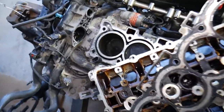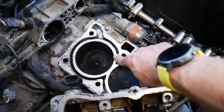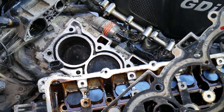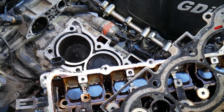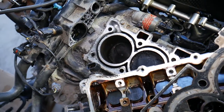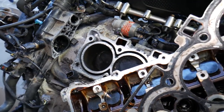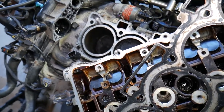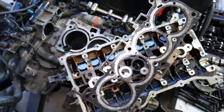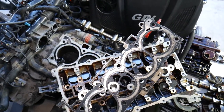In some cases you may develop a small coolant leak into the combustion chamber where coolant disappears without any visible external leaks — it's going through the engine and out the exhaust. You're essentially burning coolant. There is a specific sweet smell to the exhaust when this happens, and you may notice white smoke especially on cold mornings. Those are the most common symptoms of a bad cylinder head gasket on a GDI engine.